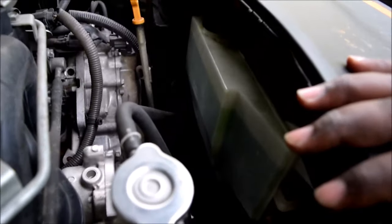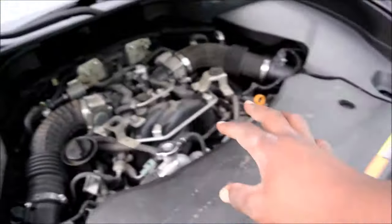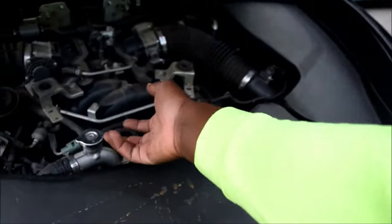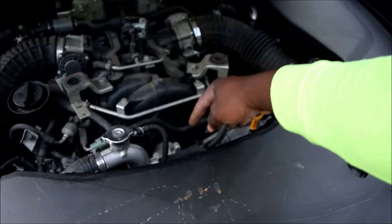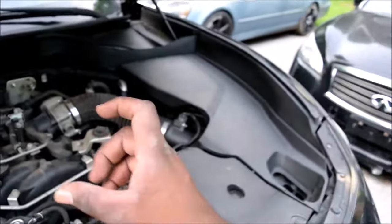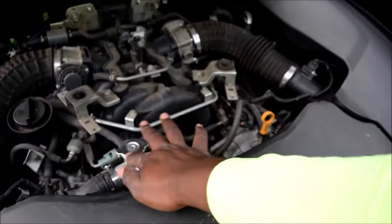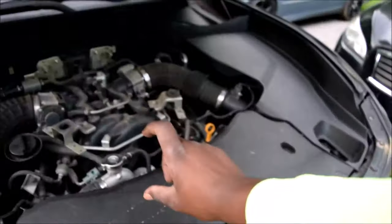So the coolant had risen above my max level. There is a caveat to coolant being a closed system: this cap is spring-loaded with a plunger that keeps coolant away from the neck so it runs down into the radiator and back into the engine. But at some point when you increase pressure in a fixed volume, something's got to give. This cap has a sticker — 137 kPa. You have a fixed pressure, a fixed volume, but you're increasing temperature.